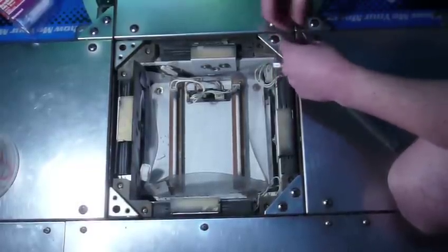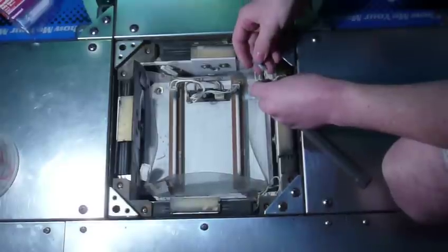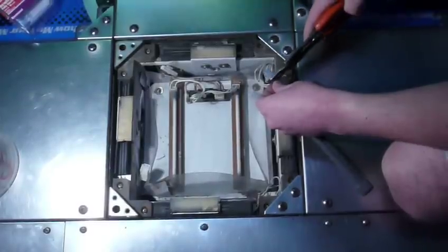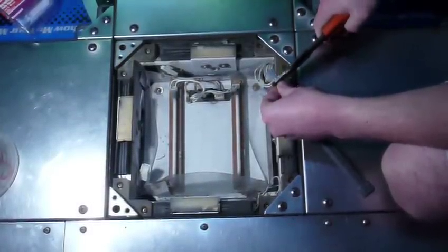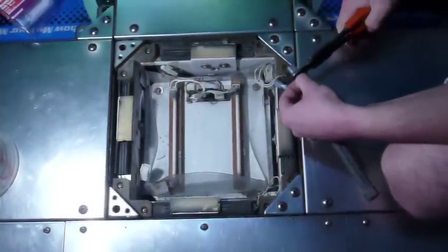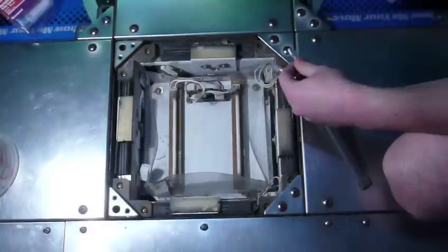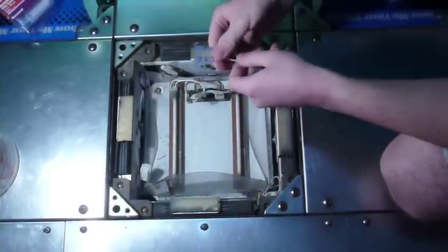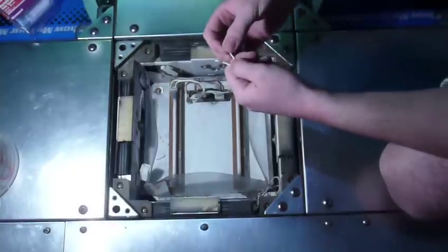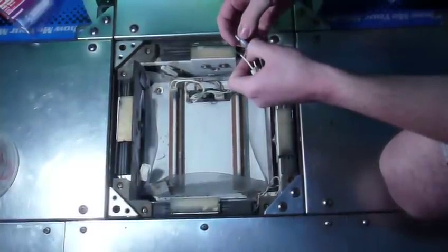This is going to be instead of our solder points again. So let's do it to this one. Some are nice and tight. Okay, so now the Pump It Up sensor part is complete. Now we're going to be doing it to the actual old sensor side, and we're going to be doing the same thing, just putting the wire in here and crimping it shut.